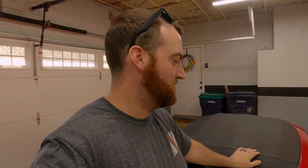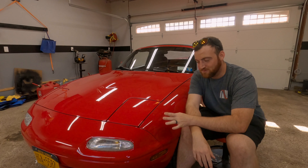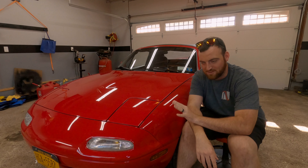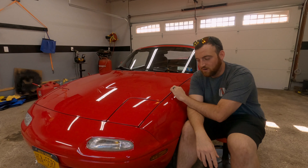The first thing you're going to want to look for when you show up, and this is the biggest red flag — unless you're okay with a rotting, falling apart car — is rocker rust. Miatas, especially north of Virginia in the Rust Belt, are notoriously bad at rotting away. We get salt and rain up here, and when it comes together, it's the perfect storm for a clapped-out Miata. The reason it happens is because rain rails don't drain, people never check, and over time water just builds up in the rockers and starts to rot from the inside out. So if you see it on the outside of the car, it's already too late. It can be fixed — this car has had rocker rust fixed before and it looks incredible still three years later.